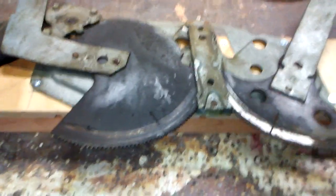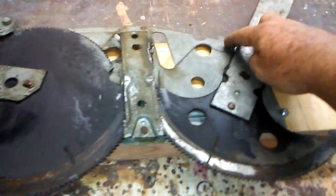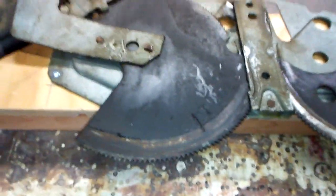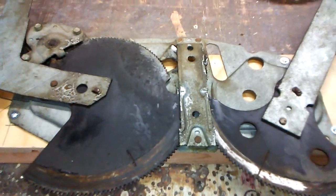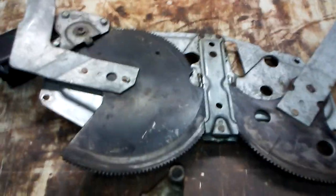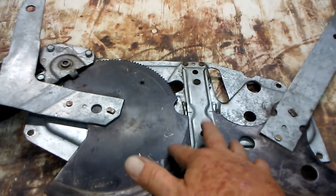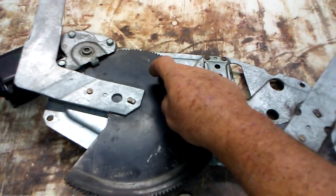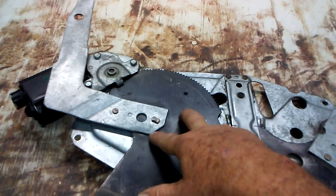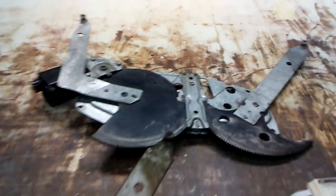The whole assembly slides back inside the door through one side or the other, then you bolt it up — there are four bolts total. If you do what I did and take the motor out without locking the gear, you'll lose the position on the arms and it becomes a nightmare trying to figure out where that position is. This arm is under a lot of spring tension and snaps back like a huge mousetrap, so lock it first. Good luck with your repairs. Thanks for watching.